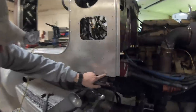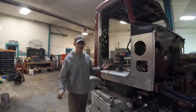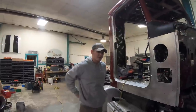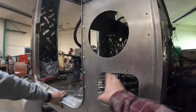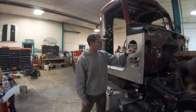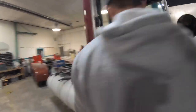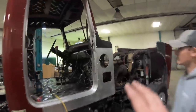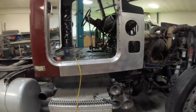These ones are going to be a little bit difficult right here with the cab mount bracket. But as you can see, we do have to drill out these holes — that's only one, two, three, four, five holes on each side. Remember, these panels are built for the '94 and up truck and we're kind of doing some retrofitting with the new EVAP system right here, the new AC system. All the holes line up perfectly. Even look at the fitment back here — it is on par. Truck Shrouds does an amazing job with these panels. This is a factory Peterbilt cowl, but even just pairing that up with a Truck Shrouds side skin — just incredible.